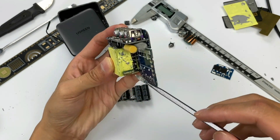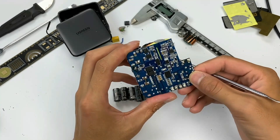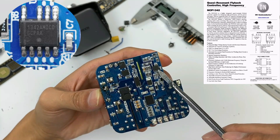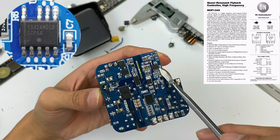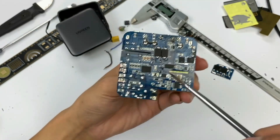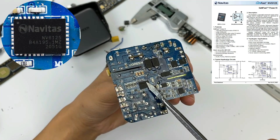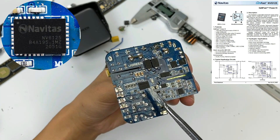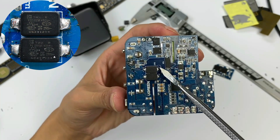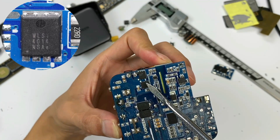There is a small capacitor on the other side, used to power the master control chip. On the back, the master control chip is the ON Semiconductor NCP-1342, which is very common in high-frequency QR flyback topology. The GAN IC of the primary circuit is the Navitas NV6125, using a QFN 6x8mm package. It integrates the driver and GaN FET to reduce external components. There is an optocoupler for output feedback, and two SMD Y-capacitors from TRX. A tiny chip is the synchronous rectifier controller, with two synchronous rectifier MOSFETs next to it.